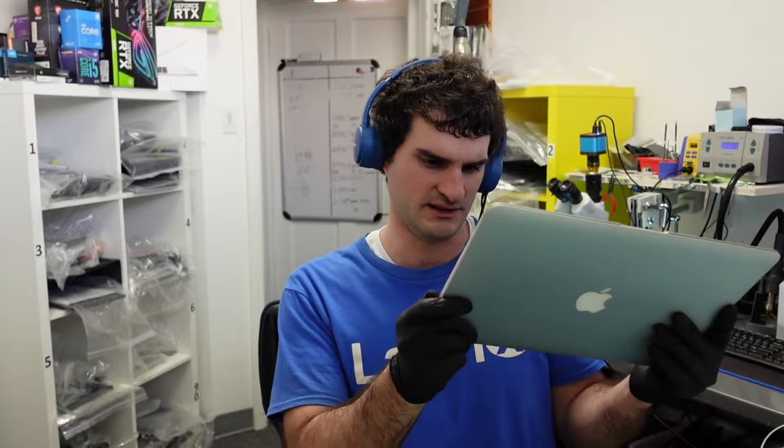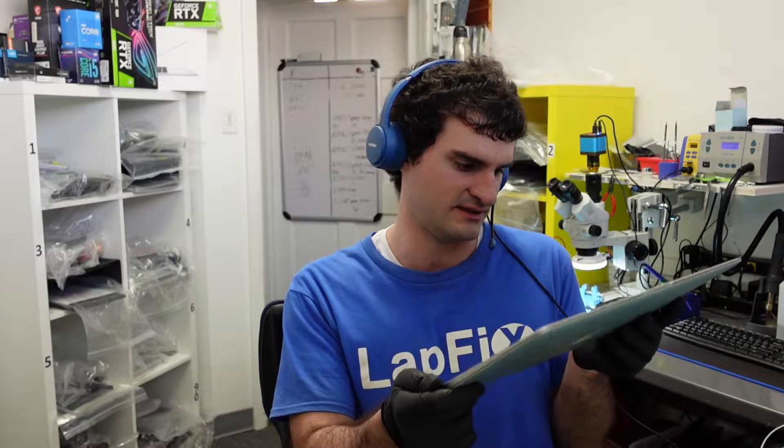So it's not powering on. I do have it open. I don't see any obvious damage or obvious liquid spills going on. I know it's getting an orange light and there's no power on it — no fan spin, nothing. So let's go ahead and take a look at it, or at least let's remove the board, see where the damage is, what's going on, and then go from there.